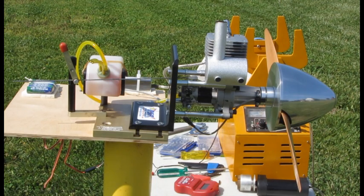This is the Melody MLD 35. It came from Surmark. I'm running 32 to 1 gas mixed with Klotz model lube. Probably should be running 50 to 1 — I think I would get better performance, but this is break-in.